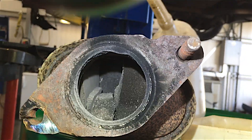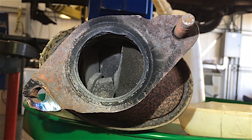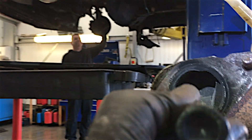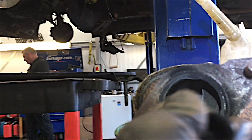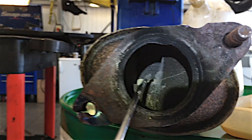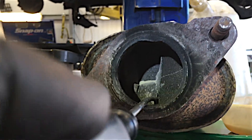So there you go - that's how easily your exhaust can get blocked up. In this case it actually stopped the car from even revving up - if you left it ticking over it would cut out. All that breaking up has obviously completely blocked the gases from getting through the catalytic converter into the back part of the exhaust. It's been quite a long time since I've had a blocked exhaust and I actually had to think about this one a little bit - I was scratching my head wondering why the hell this car wouldn't rev up.